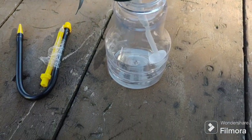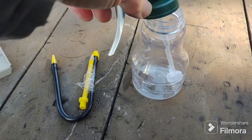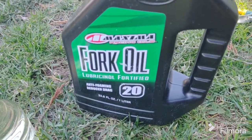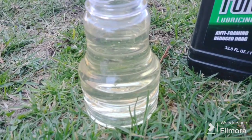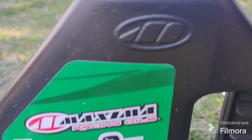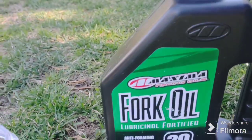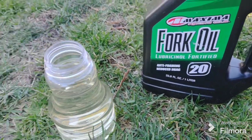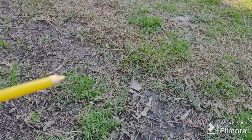This is 9.5 ounces, so this will give me an idea of how much I'm putting in each side. I'm using this fork oil - it's almost totally clear, just a little yellow tinge. If this doesn't work, it's not the fork oil's fault - it's that my lever shocks are shot. I know I need new ones, but just having a little fun today. It's all filled now - since it's brand new you always get a little squirt just in case there's something inside the tube.